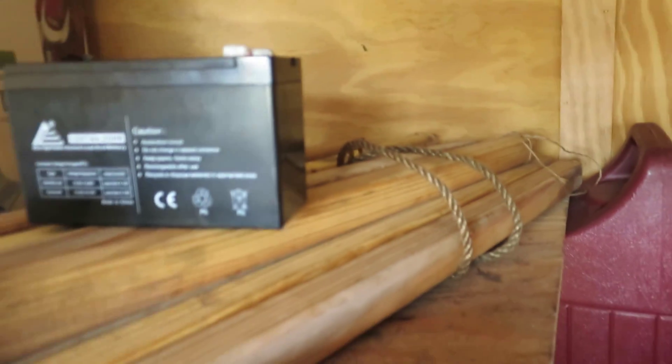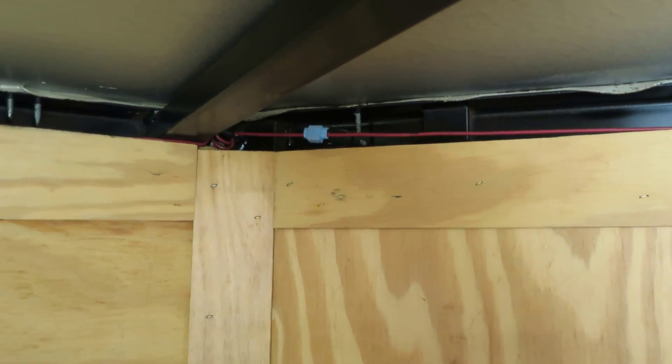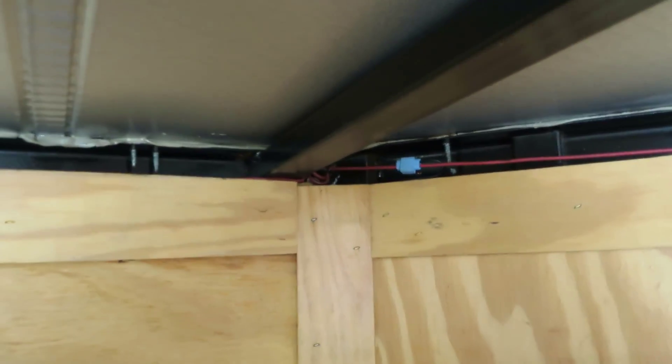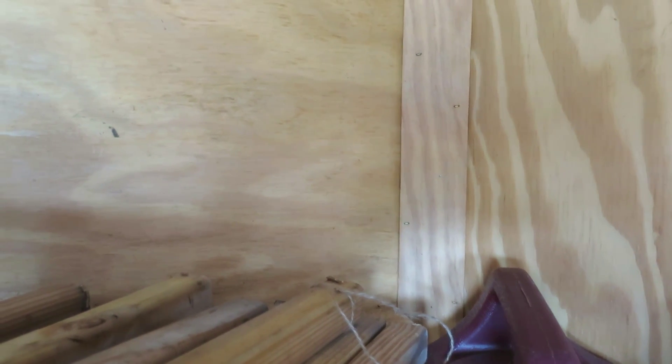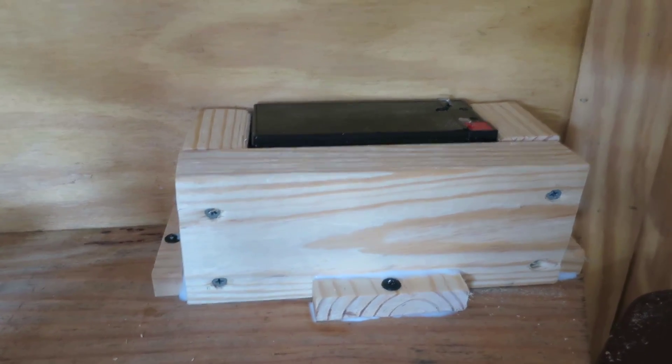Next I want to determine a good location to mount the regulator and the 12-volt battery. I'm going to go up here — I'll take these sticks out because the kids don't need those up here. Right above it you can see the red wire connected to all those marker lights — that's your power source coming in from the truck's parking light circuit — and anywhere there's metal is your ground. Doesn't get much simpler than that. Just run it from here down, mount the battery box, seal up and tighten all connections, and that's a terrific place to work from.